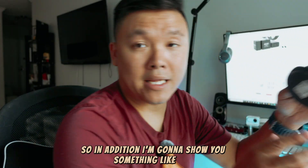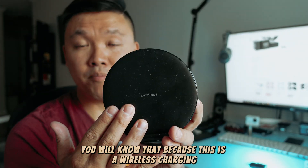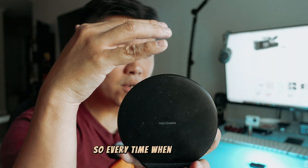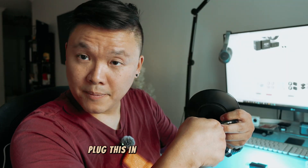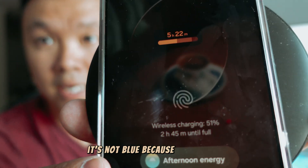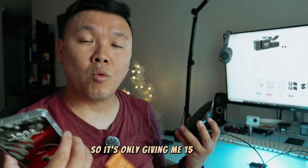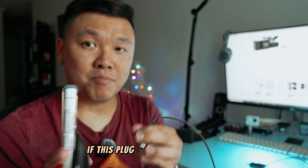Now I want to show you something about wireless charging. Wireless chargers can only provide 15 watts or lower. So every time you use wireless charging — even if I plug in a fast-charge cable and then place my phone on top of the wireless charger — it will still show green, not blue, because it's just a normal wireless charge at 15 watts.